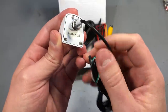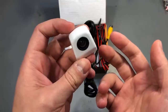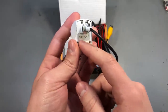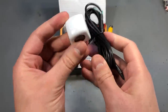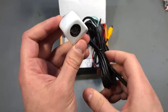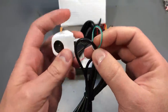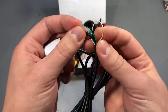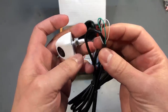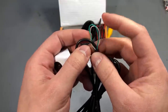In terms of image sensor, if you go for the cheapest you'll get a crappy sensor with poor low light capability, so I spent a little extra and picked the Sony CCD option. I checked the image quality with a small monitor and it looks nice and crisp — definitely worth spending a little extra. The harness has two wire loops for enabling or disabling the fixed trajectory lines or for mirroring the image; by cutting or connecting these wires you control that feature.